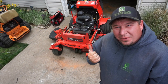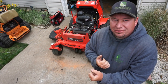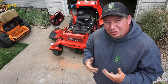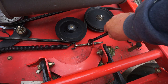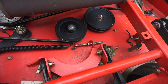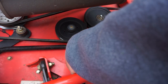Something I do when putting these belts on — I loosen the spring tensioner quite a bit. That way I'm not forcefully having to rotate the belt around a pulley, pinching my fingers and stuff like that. A few cranks with a wrench loosening that takes a lot of the pressure off the system. I loosen it to take pressure off the tension, then I take a pair of pliers just to hold it from wanting to rotate, and then tighten it back up.